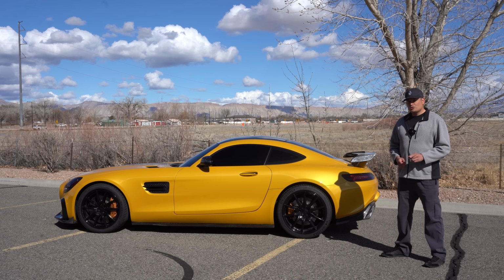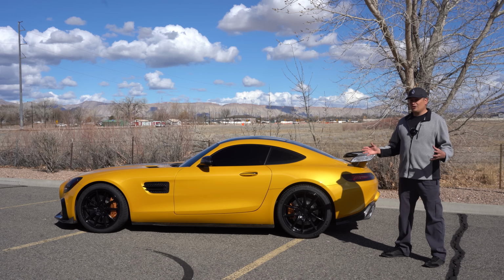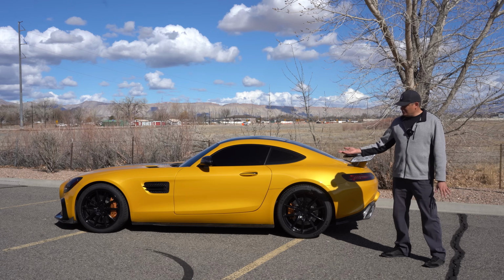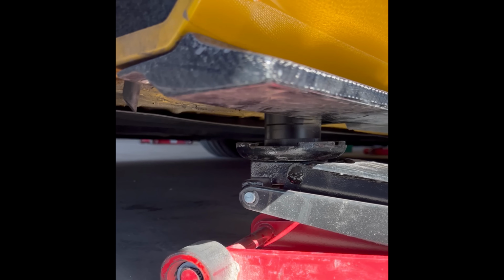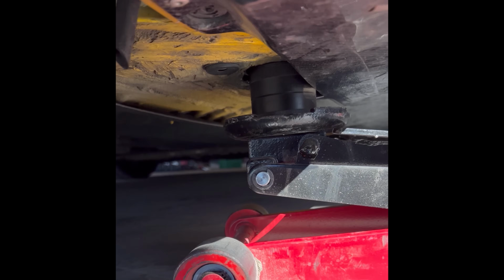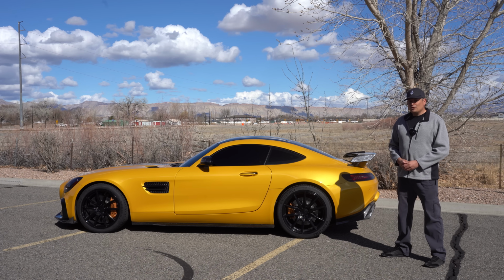And something that goes with that is look underneath the car, and the reason why is that the jacking points on this car are some of the most awkward jacking points I've ever experienced in my whole life, because they're right next to these carbon fiber side skirts. So you just want to make sure that these side skirts have not been crunched and that this car has actually been lifted correctly.